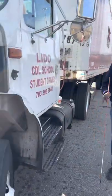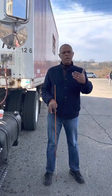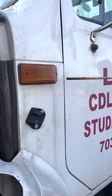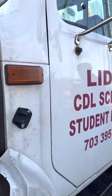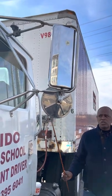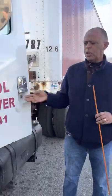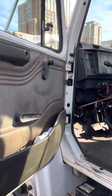The B section starts from here. If they ask you to do B, you are not going to open the hood. The B section — we're going to check from the door. We have a signal light here — the same inspection: no missing screws, properly colored, no crack or broken lenses, and it has to be in working condition. We have side mirror here — check all the brackets, all the bolts, nuts need to be tight and secure, no missing or loose. The mirror itself, make sure it's not damaged or cracked or broken. We need to open the door and check the hinges — make sure the door hinges have to be tight and secure, no crack or broken.